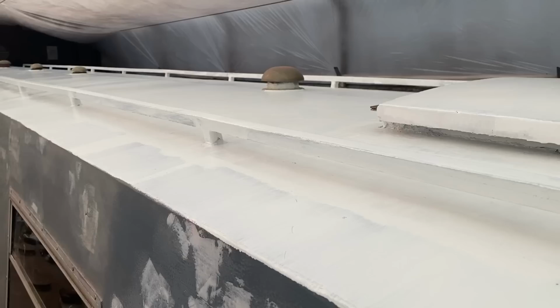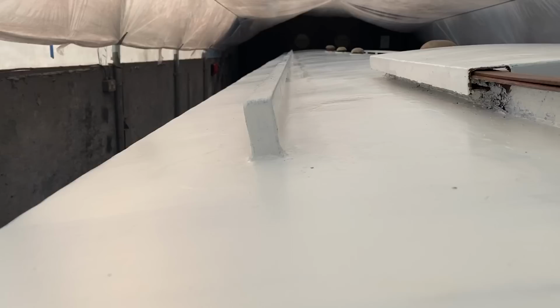Basically the full 12 days, yeah, we've been working on it. So today's the 13th day. And we're tired. But basically we rolled a little section on, tipped it off with a brush, rolled another section off, tipped it off or laid it off with a brush, all the way down the roof and the poles as well. And it looked nasty.